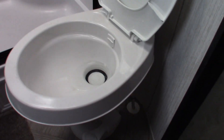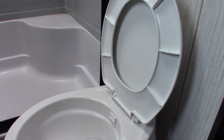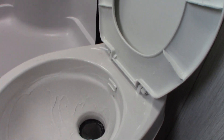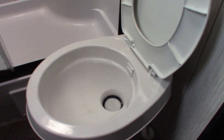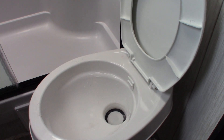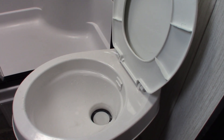Your toilet is an RV toilet, so it sits directly over a black tank. This is the flush pedal. When you get to the campground, hook up your power and water, come in here, put a dose of chemical in the bowl, then step on the pedal — it'll hold long enough for about a gallon of water to go into the black tank along with the chemical. If you run it dry, it's going to smell terrible and get clogged. Always have chemical and water in there.